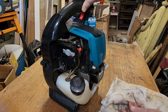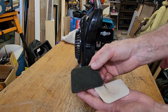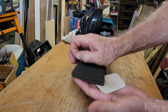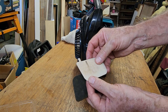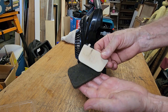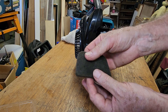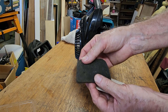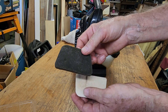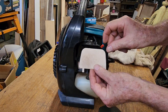I've washed the air filters out in petrol. I'm not going to blow compressed air through them as it would create quite a volatile mixture in my workshop, and the air compressor can be quite harsh on air filters — you can actually damage some filters with strong jets of air. I'm going to leave these to air dry; petrol evaporates pretty quickly. If you've got an engine that only has a foam filter, I like to wash them in two-stroke fuel because it cleans them and leaves a light film of oil which helps trap dust.